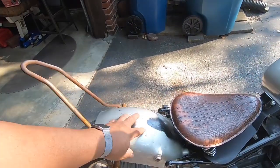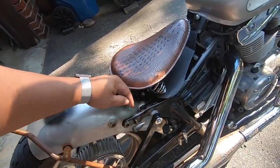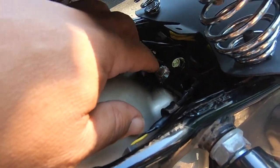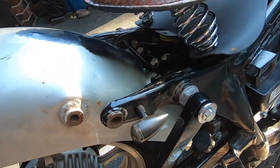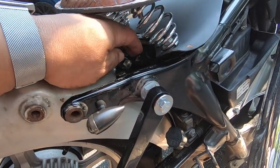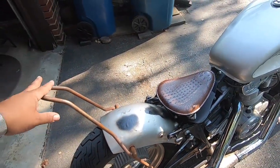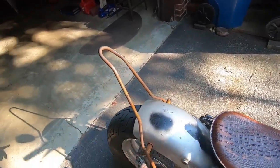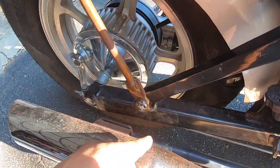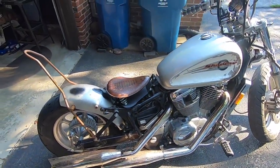What I did was take the original fender off, chopped it at the original end, and flipped it around. Then I created this bracket down here for it — literally just a scrap piece of metal I found at the scrapyard. I drilled some holes here, drilled some holes there, right into the frame, and that's that. Then I got this 30-inch sissy bar and welded on these bungs and tabs so that it would fit onto the strut. That's pretty much all I've done so far.